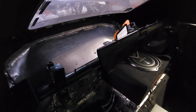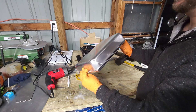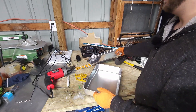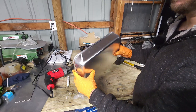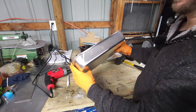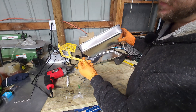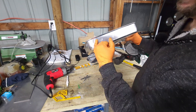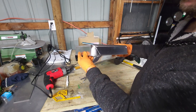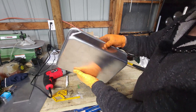It's not perfect and it doesn't look great, but it's going to be hidden by carpet anyway. Now the last cover — I'm actually going to use a cake pan. Not going to use the lid part, but the contour of this matches exactly what I need and it's about as thick as the original cover was. I used this to find the angle of the hump in the middle of the car and transposed that onto here. I'm going to cut across with my band saw and this should run over top of the two fuel lines.